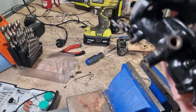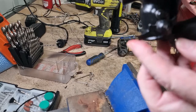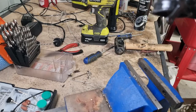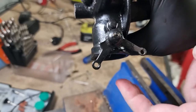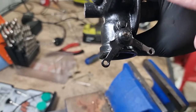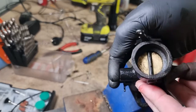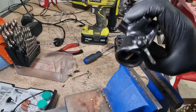Okay, so definitely you can see my ungloved hand because I had to use that. That's working very well. I couldn't slip that over with the shaft still being on there. So I did have to reverse, had to take the staple out, take the butterfly plate off, withdraw the shaft, put the spring over there, and then you can go back the other way. But having done it once, it's pretty straightforward. I'm really happy with that. That's great.